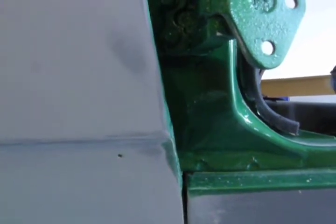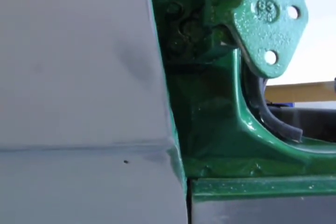And this is important right here. You see that overspray on the fender? You got to get that out, because that's adhering to unscuffed primer. And when you throw your base and clear onto the outer surfaces, that might lift. So we gotta sand that out better. So we blocked everything out. Now we're just doing the final touches along the edges and stuff like that.